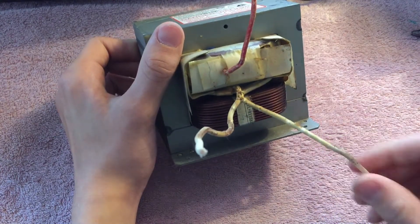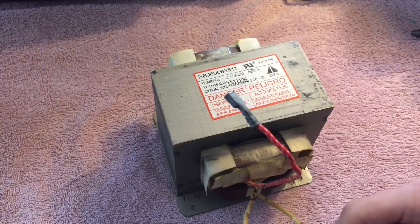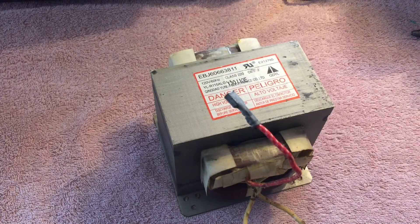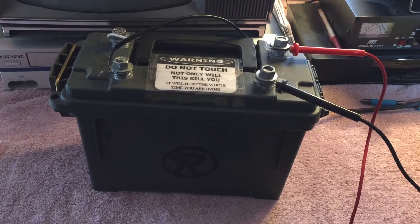I like to leave them on just in case I do need them for something. Now that we know what needs to go where, you may want to know exactly how many volts the transformer is outputting — maybe how many turns, what the ratio is. A lot of people will say it's a 2 kilovolt transformer, but in reality, from different microwave ovens you could get anywhere from 2,000 up to 2,600 volts. If you're just drawing arcs to make a spectacle, you probably don't care too much, but if you do want to know exactly how much it's outputting, here's a simple way to do it.